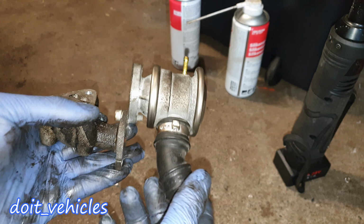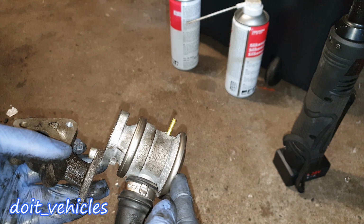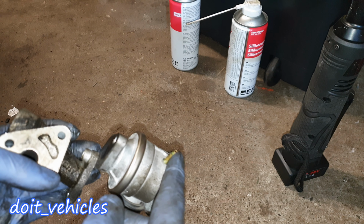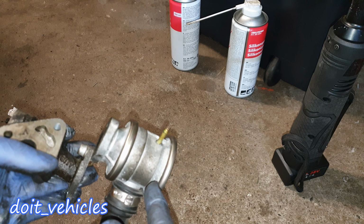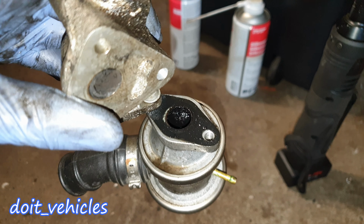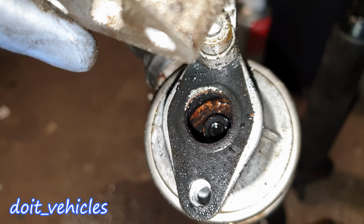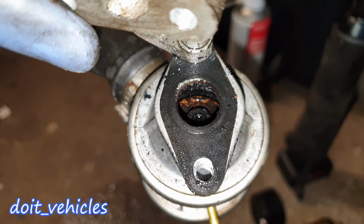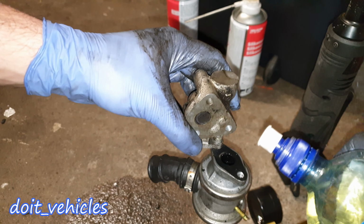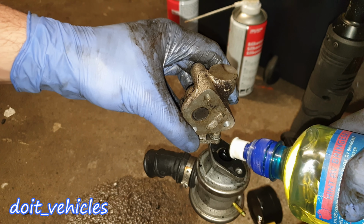Remove the PCV hose, this rubber hose, and you can just submerge this in gasoline. Make sure that the gasoline doesn't go through this nozzle, through this valve. I'm gonna let it sit with that fluid in there for a couple of minutes. Looks like there have been removed a lot of carbon from there, as you can see. But I'm going to add some gasoline. I believe gasoline is gonna be a little bit more effective.